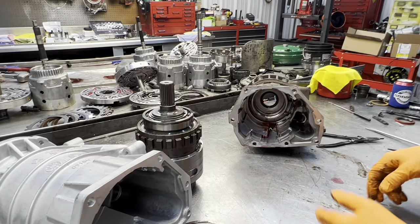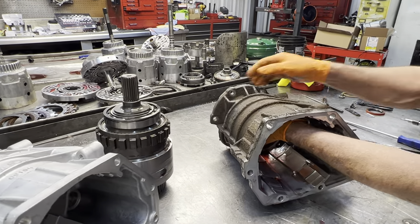We're going to open this snap ring up right here and pull this overdrive section out. You want to check this bearing for any noises. We're going to clean all this stuff up here, and there's a snap ring down in here I'm going to pull out.